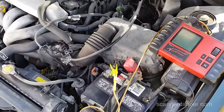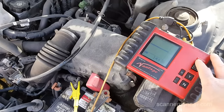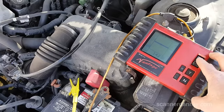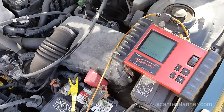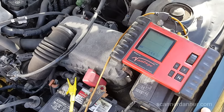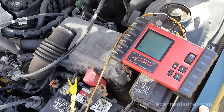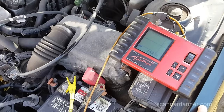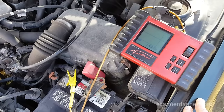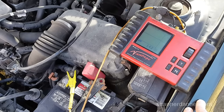I've had it running now for about 10 minutes and my voltage levels are much, much better. Last time we were looking at this on a half-second screen — I changed it to five seconds. So you see the difference in the ripple. As a warning: do not overanalyze alternator ripple when you have a completely dead battery. I'll put some links in the description for other videos I've done on alternator ripple and diode problems.